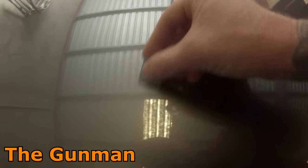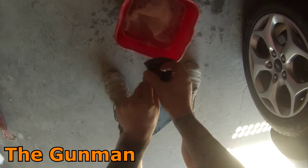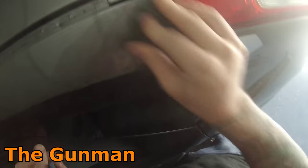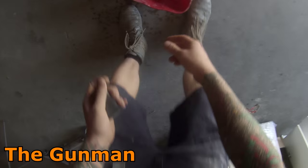I'm checking over the rest of the paint job for little bits of dust that landed in it while painting. I'll shave the tops off with the tungsten block and then hit it with a bit of sandpaper. Shaving the tops off first means it's already flat before you start sanding. You can actually polish straight over without sanding, but you'll get much better results with a light sand using a block or a mini orbital sander with 1500 then 2500. At the time of making this video I hadn't got that mini orbital polisher yet.